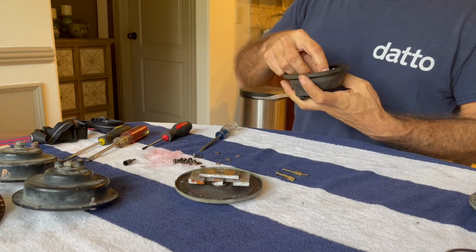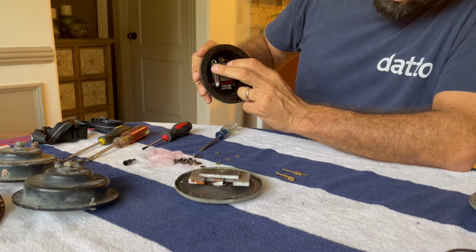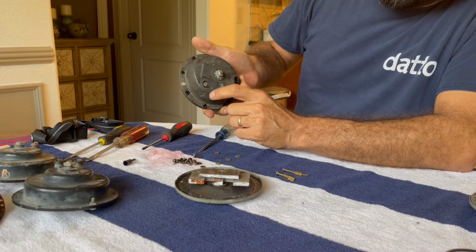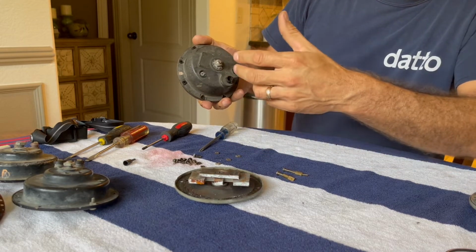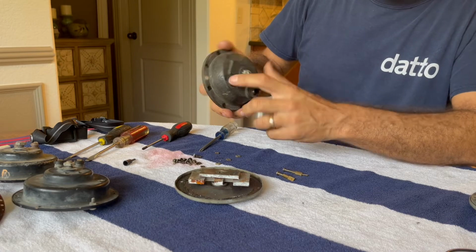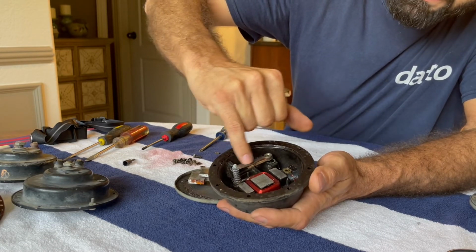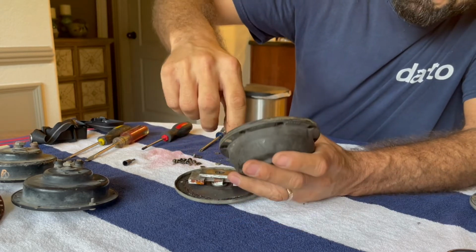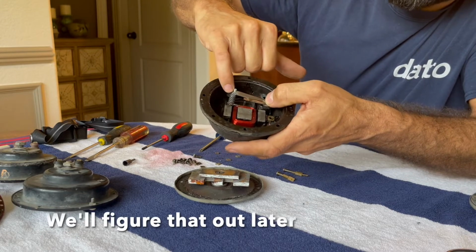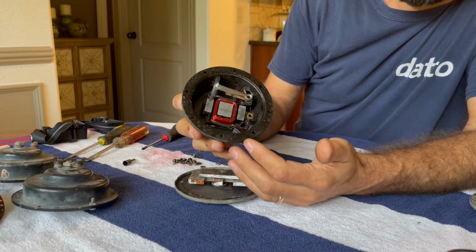That adjustment screw. Okay, so aside from making sure that you have conductivity, low ohms between these 2 points, there's discussion about how this screw on the back here will adjust things. If you're getting a weak pathetic noise, or you're not getting any at all, or it's not quite the right noise, you can adjust this screw. And basically all you've got here is just a screw coming up through this threaded plate here on top, and a spring in between the two there. I don't know enough to tell you exactly what that's doing, but obviously it's an adjustment. And that's going to, as I understand it, potentially change whether or not it's working at all, as well as what the tone is like.